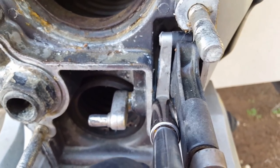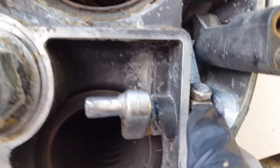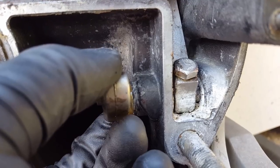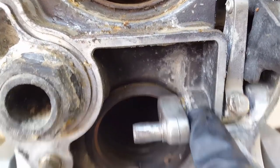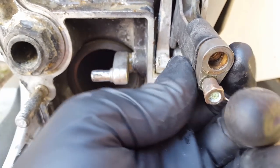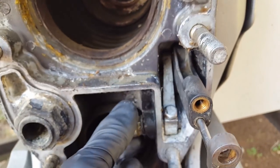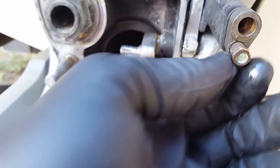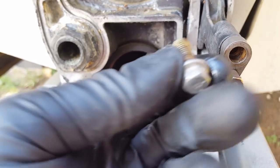Go ahead and slide the bell crank back and tighten up the 7/16th. We have just a little gap there — this isn't a contest to see how tight you can make it; definitely don't over-tighten. You'll still see the gasket compound in there. Do a quick function check because once you tighten this bolt you won't be able to. Make sure the sealed surface is good, the small bolt is tight, and the 5/16th down here is good. That leaves the 3/8th that goes in here.